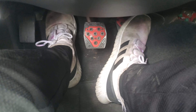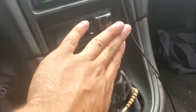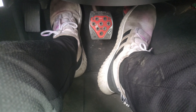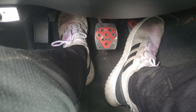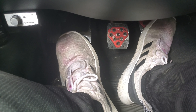You just go: clutch down, right? So this is my clutch right here. Clutch down, put it in a gear — third gear, we'll say — for downshifting, and then literally just go like this. Blip, that's it. Look — blip, that's it. You're basically just revving your engine. So you just go: clutch is in, blip, and then ease off the clutch, and you'll catch it, you know what I'm saying?